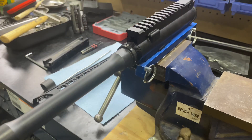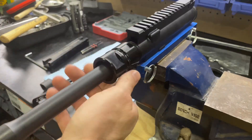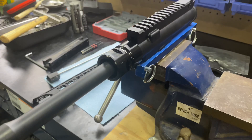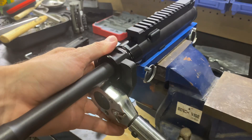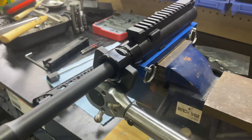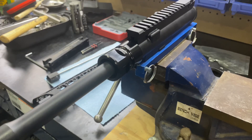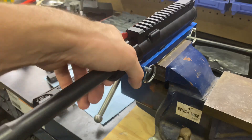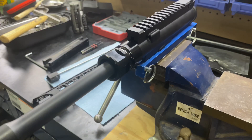So we now want to put the barrel nut on. We get that on hand tight, and we're going with our handy-dandy torque wrench here. I have it set for 45 pounds. I've had people say that they do theirs up to 60 pounds and even past that, but that does seem kind of like overkill to me. 45 pounds is usually what I do mine at, and I've never had any of these come off. I've built over 500 custom builds here.